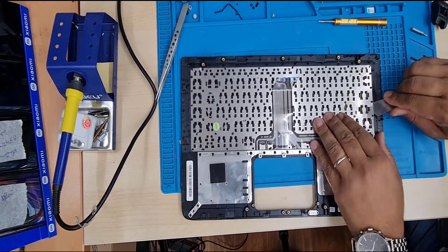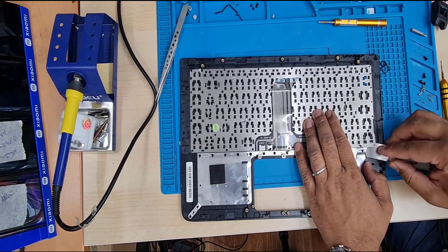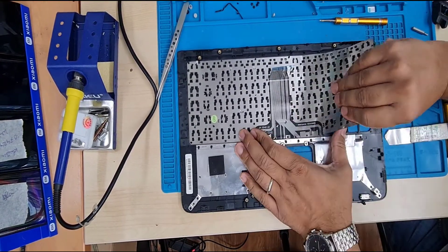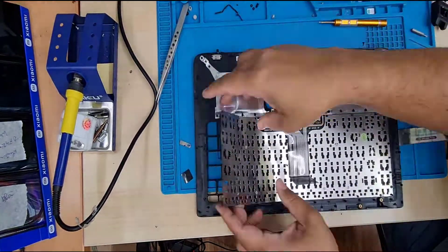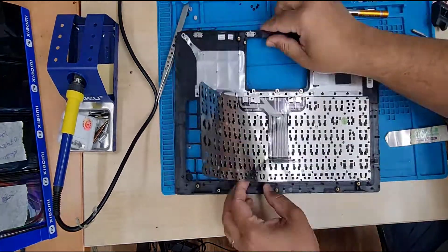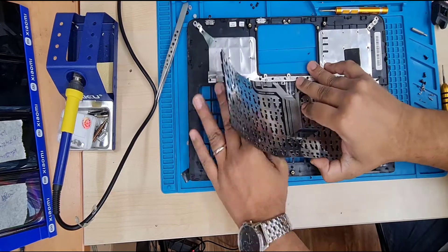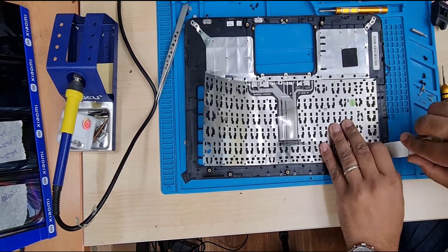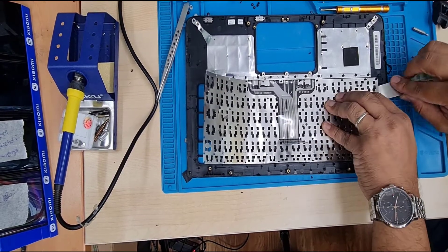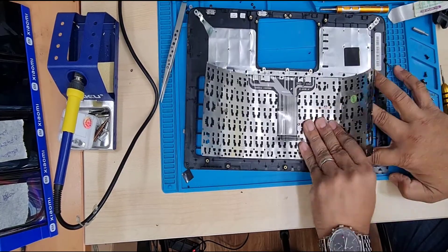And now, you don't need to apply any heat or a soldering gun to melt down the rivets. What you can do is just gently pull the keyboard and it should come out. It's going to make a lot of noise — just keep your fingers quite firm and pull it gently. It should come out after a little bit of time. Then it will be ready to apply the new keyboard into the frame and put it back. The job would be done.